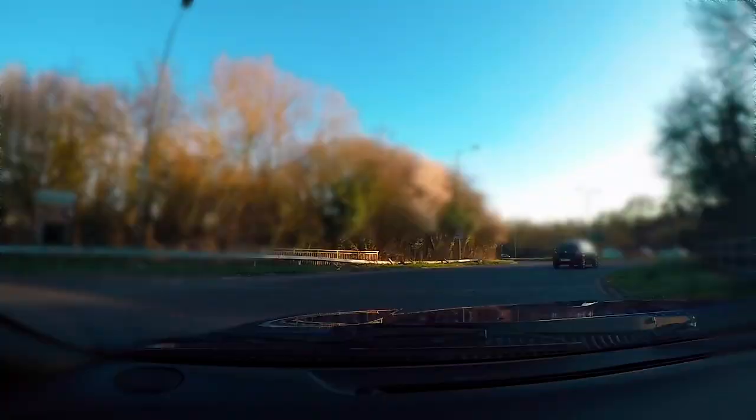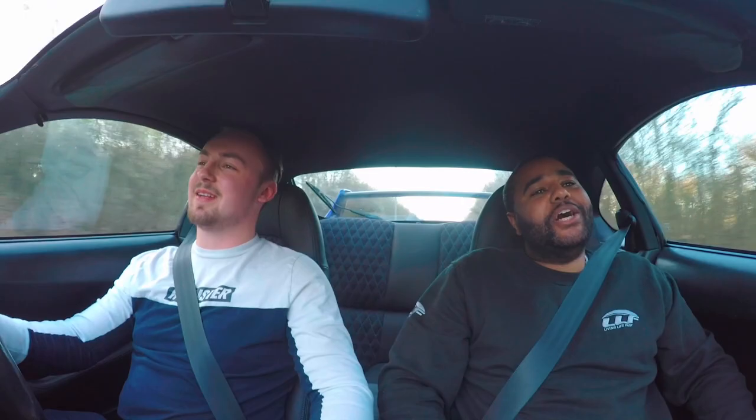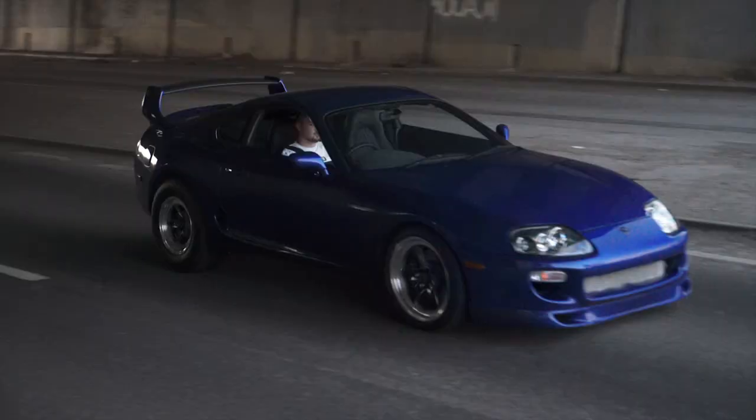Have you spent a lot of money on it? Yeah, a lot. It's starting to go supersonic — there's a bit of lag, and then when the boost hits it pulls you through. You should get a short shifter. The tyres feel a bit stringy when you accelerate in. The suspension's soft on the back so it squats and puts the power down rather than spinning the tyres.